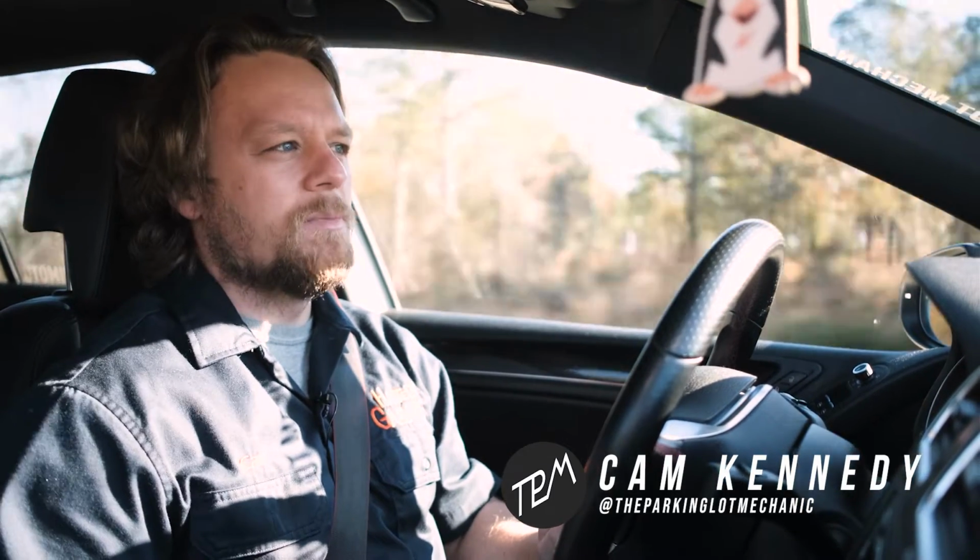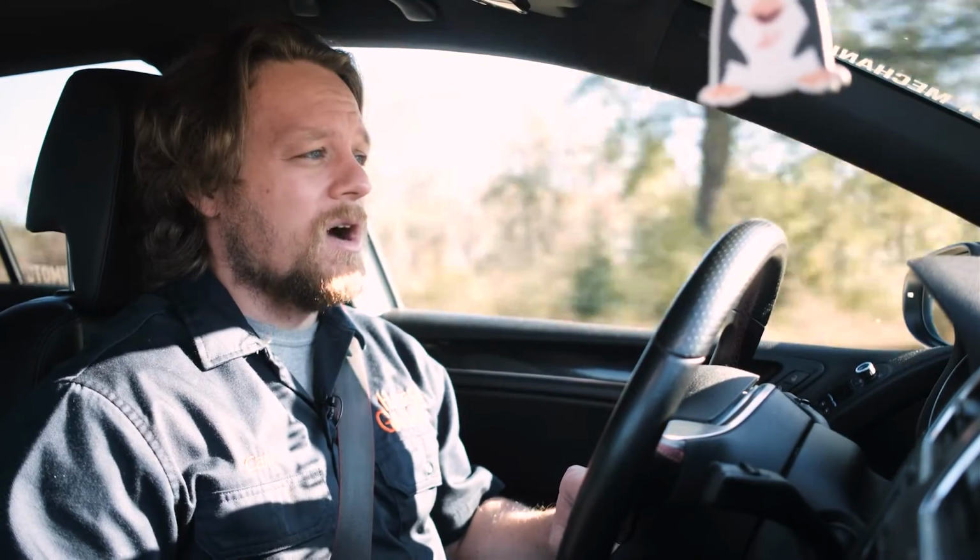Hey guys, we are here today for episode 3 of trying to solve my power loss problem. It's been quite the saga. We're starting to get into replacement parts and figuring out where that boost leak is, because I know we have one now. Stock was running 7 PSI, stage 1 tune is running 9, even though stock should be 9 to 10, so I'm a little bit behind.